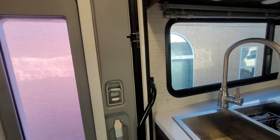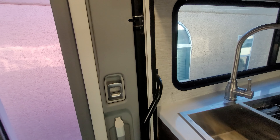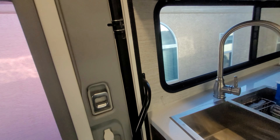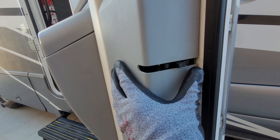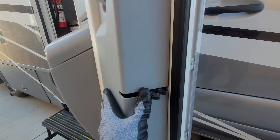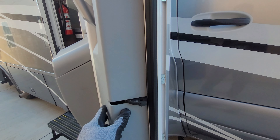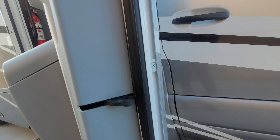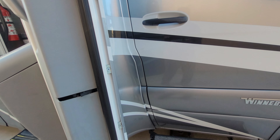I have adjusted my door in the past — these doors do move a little bit. The hardware eventually moves so you may have to adjust this a couple of times. Just like cabinet hardware, it is very finicky work. Now if you look at this door from the side, what it has right here is called a slam latch — very similar to a car. It has two positions: a first position where it latches the door, and a second position. Both latches need to be in the second position for the door to be firmly closed. Just like a car door, you can partially close it and push again to make it latch all the way flush — that is the issue.